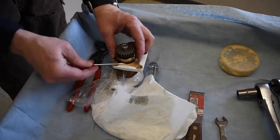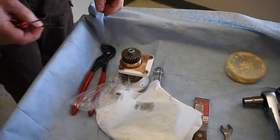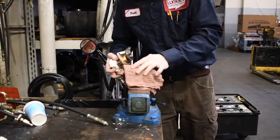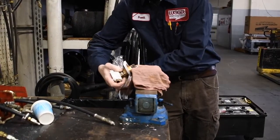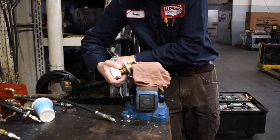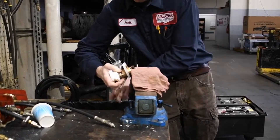The pump will come out with a little easy rocking to disengage the gear teeth. Remove the O-ring from the pump housing. Wrap the gear well in rags to protect it, then clamp into a vise to release the drive gear, removing the nut to access it. Be certain that you clamp only on the hardened gear — clamping onto the brass body will produce soft points that can fail.